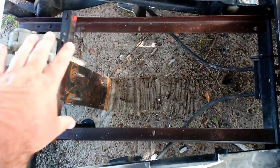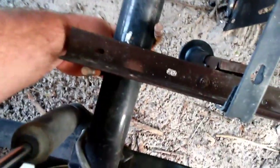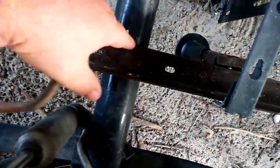We're going to build a swing arm out of these L brackets. What I'm going to do is weld another L to make it square, and then I've got these U-bolts that actually came off a Club Car rear end. They'll go just like this and pull down tight to hold it in place. I'll probably tack it right here so it doesn't move, and on that end when I bounce on it they pull backwards.